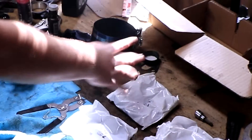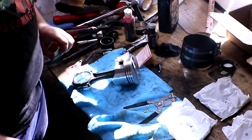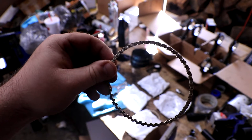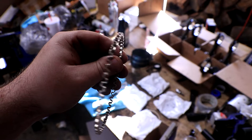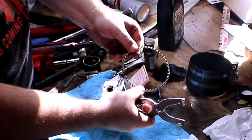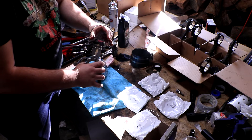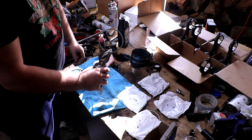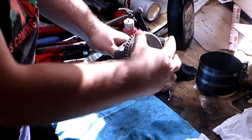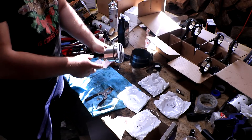I've got four different bags of piston rings right here fresh out of the box. You want to start with one of the oil rings — these are the wavy, wiggly-looking metal pieces. Find where your oil ring breaks — there's a little space in it — put one side into your ring expander, then the other side, and when you squeeze it'll open right up. Then slowly slide it over the piston and pop it into place. Super easy.